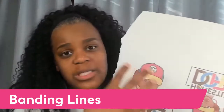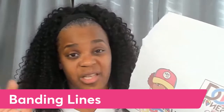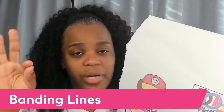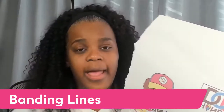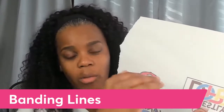If you prefer to not really see these at all, you can use a higher setting such as premium matte. If you print on that, it's going to take a lot longer to print. The reason it takes so much longer is it's putting out smaller drops of ink closer together, and it's going over a section more than once so that it fills in all of those gaps.